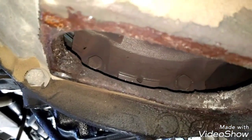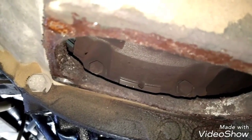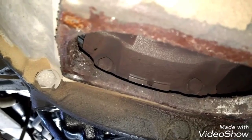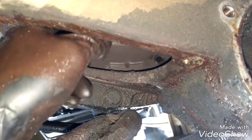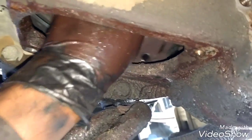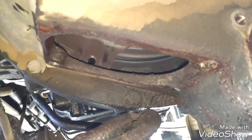I'm going to remove two bolts, then rotate the engine and remove the other two, and so on until I get the press completely released. Now the clutch is completely detached. It's fairly smooth as you can see — it moves around very easily. Now the transmission is ready to be removed completely.